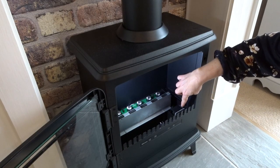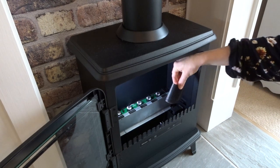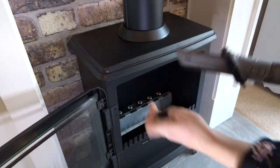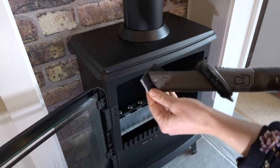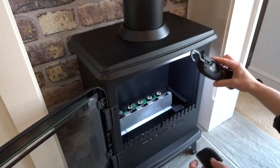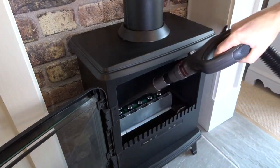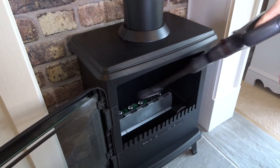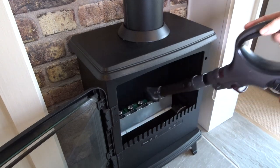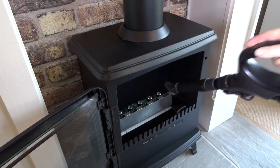The other thing I want to clean is — in front of the fan — there is a little filter pad. All I do is get my hoover and give it a bit of a hoover to make sure any dust has come out of the filter, then pop it all back together. I also like to go in gently with the hoover to get up any dust sitting around any of the elements or the lamps, and make sure that's all clean.